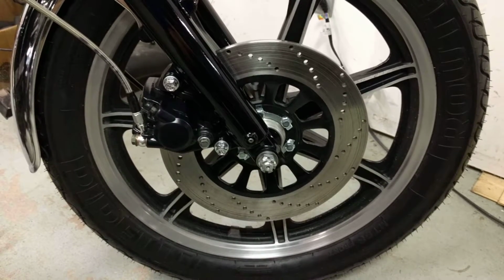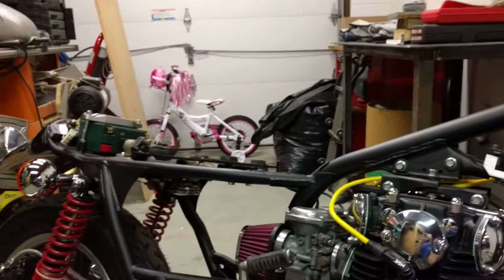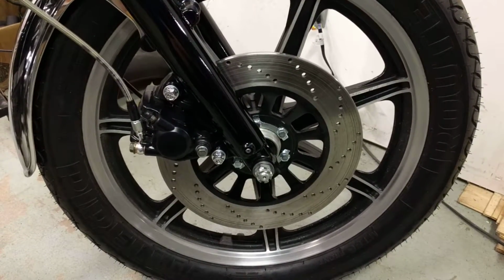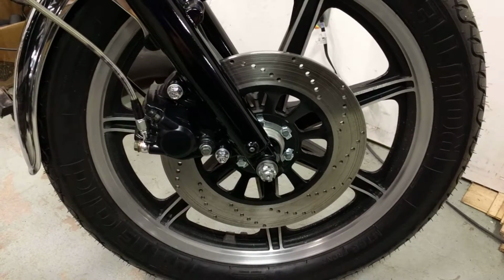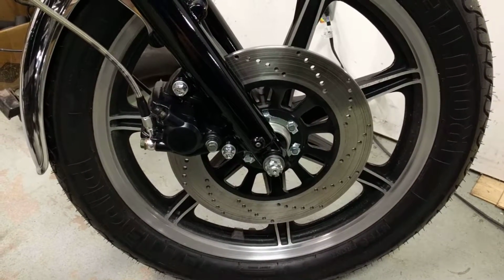This is January into February, and I won't be riding until probably May or June once I finish doing all the wiring on this bike. But I'm going to follow up on this theory, and this is just what I've read. It's not about lightening. It's not just about looking cool. It's not really about venting gases. When you're talking solid rotors on a 70s or early 80s bike, it's just about trying to keep that material from galling up on the pads.